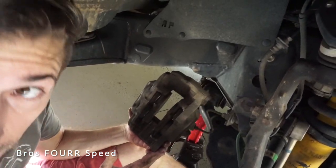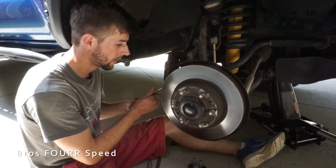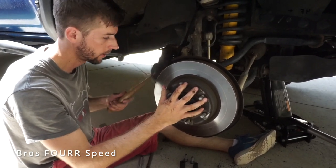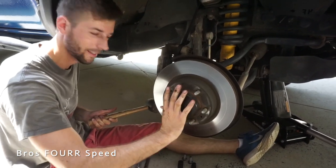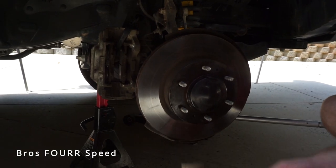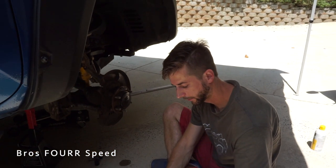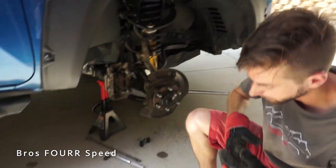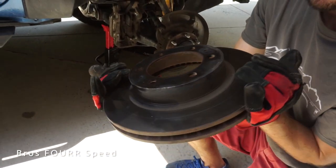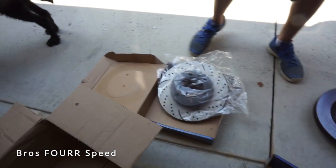We strapped the caliper up so it doesn't fall. I got the rubber mallet and I think we just need a little persuasion - I'm going to try to tap the back side and rotate it. It's just rusted on a little bit. After a little persuasion and a couple different methods, the copper hammer did the trick and we were able to get it off with pretty minimal damage, just a little on the edges.